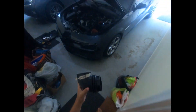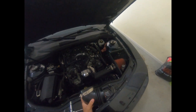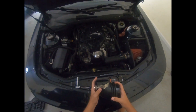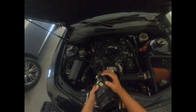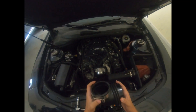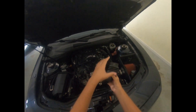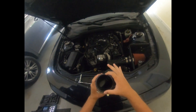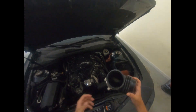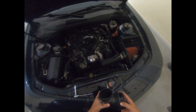This is the coupler for my cold air intake — it's a $60 intake from Amazon. This coupler that came with it fits on the stock throttle body, and it actually fits the 80 millimeter as well. Those of you with K&N or Corsa inductions will need to buy a larger silicone elbow coupler so it fits on top of the 80 millimeter throttle body. I'm fortunate mine already fits, so I don't have to spend extra money.